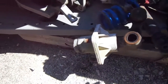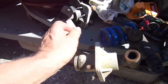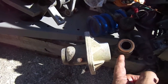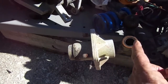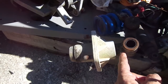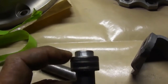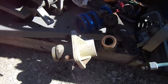On these golf cart spindles right here — I got several of these — what I done is I sawed it as close as I can to that, or torch it off, then torch it down. Leave you some room where you can machine that all flat and where you can machine a little over a three-quarter size hub on there so you can press it into the other part of your Cub Cadet front end.